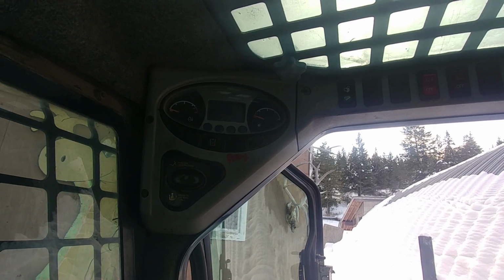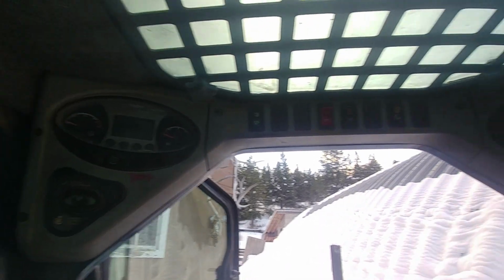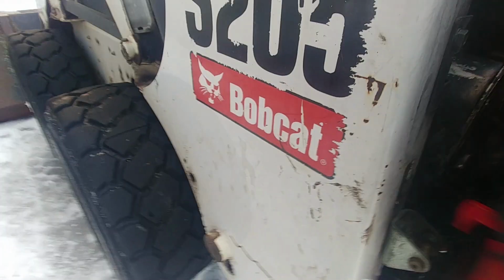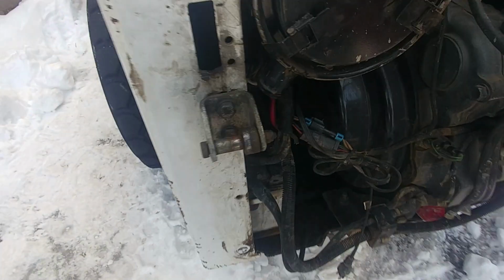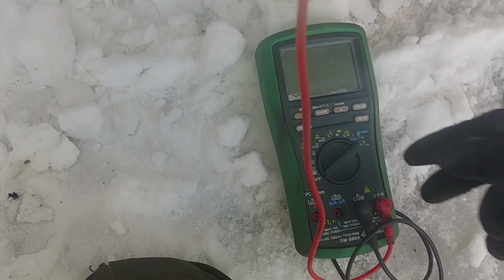As I said, a very common situation can be a loose connection at the battery, corroded terminals, or, if you have a master switch, it can be off, but that's very obvious. But let's check the battery voltage. That situation started happening a while ago, and the battery was charged overnight.